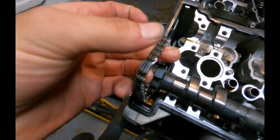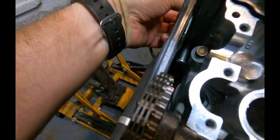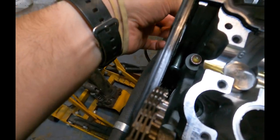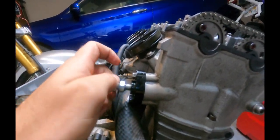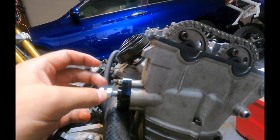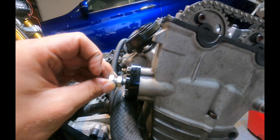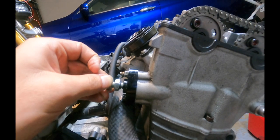When the chain stretches out due to wear, automatic cam chain tensioners are supposed to tighten automatically, but they fail very often — so people get these manual ones and do it themselves. Here we got the cam chain tensioner, bolt loose. You can tell that chain's wobbling a bit, so we're going to tighten it until we start to feel a little bit of pressure on the bolt. I feel it there — I'm going to back off about an eighth of a turn.